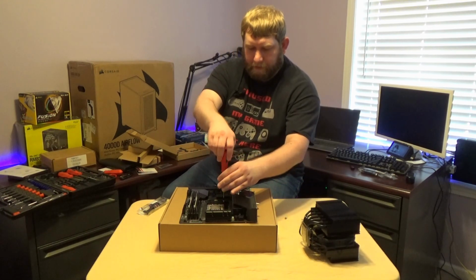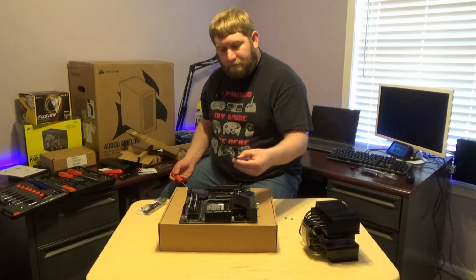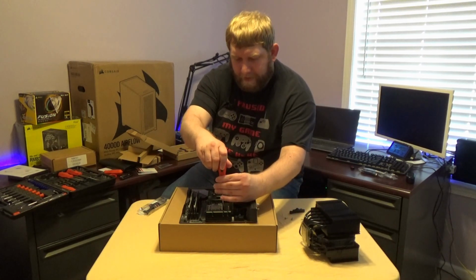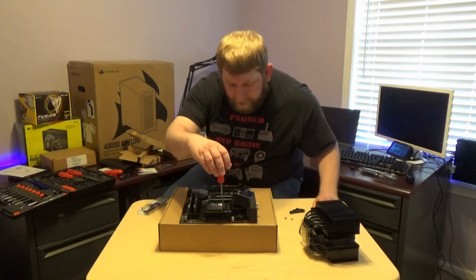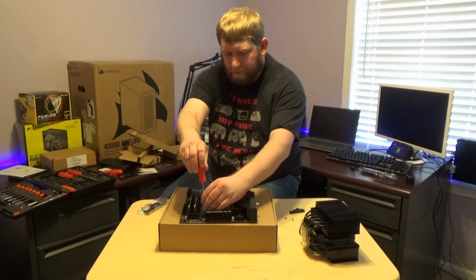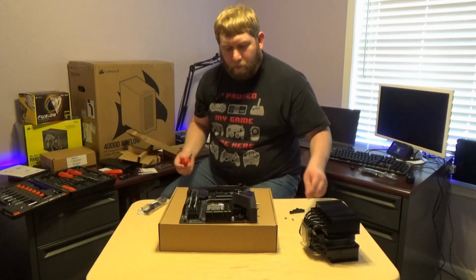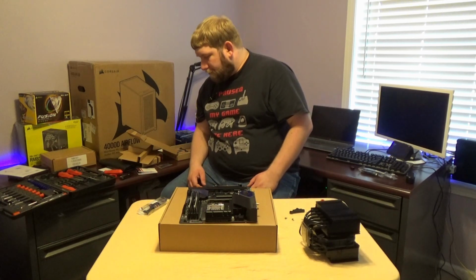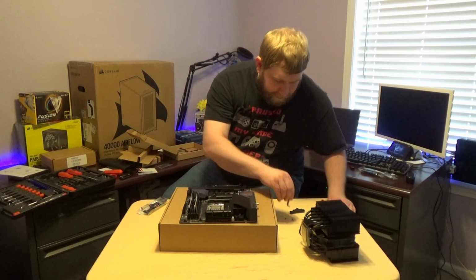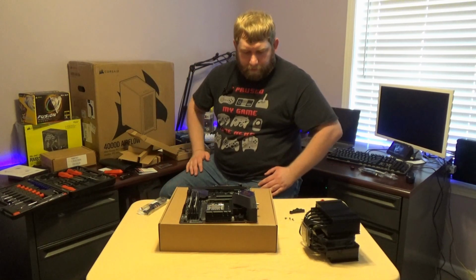the board, especially with the very, very small 0402 and 0603s, as I mentioned before, if you guys want to look those up online, they're extremely small capacitors, resistors, transistors, stuff like that on the boards. And there's actually some components potentially smaller than that on here. The smallest I ever messed with were the 402s. But barely flexing the board has potential to actually break these solder points and break the components off, and potentially crack the components themselves. And this is something that normally you will not be able to see unless you put it under a microscope, which is something that I used to have to do on the regular.